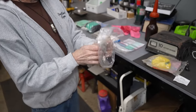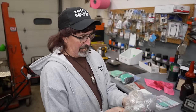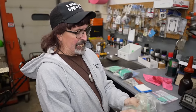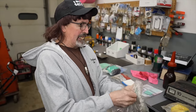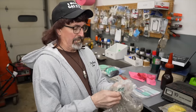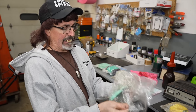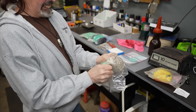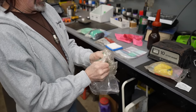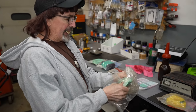Very important: change your air filter when you change the oil. A lot of customers come in only buying oil, saying they're changing the oil on their mower. I ask about the air filter and they hadn't thought about it. It's just as important — you don't want to be sucking all that dirt in. That's what wears the engine out. Think of dirt as sandpaper — it's abrasive.